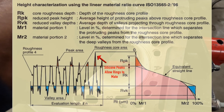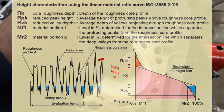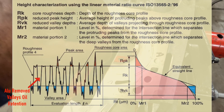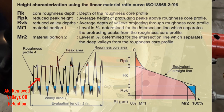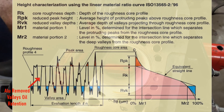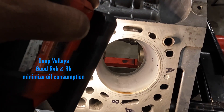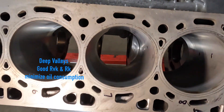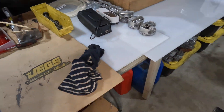You need a sustainable amount of silicon height above the aluminum, and a certain amount of aluminum must be removed from around those particles. That's the first thing to ensure good piston seal and avoid scoring for long-term service life. Next, you need enough valley depth — RVK and RK — for oil retention and oil sealing. You want to lubricate the rings and bores, and retain oil in those valleys so when the ring comes through, there's oil to lubricate it. Right now, I guarantee these bores are not in a position where they'll seal or prevent bore scoring. We'll be stepping through cylinders five and six, going through the honing process and checking surface roughness — RA, RPK, RVK, and RK.